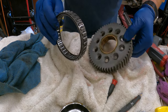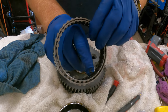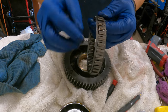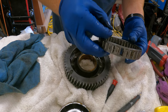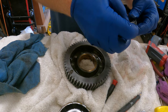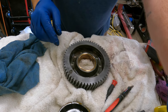If you can't lift the clutch out, you can turn it over and push on it down through these holes. There's a lip — you can see on one side how it has a lip but not on the other. That lip goes in first. Now I'm going to look at all these drive dogs and see if there's any wear on them. There's one of them falling out already — they're not supposed to do that. Either way, I'm going to replace this clutch.